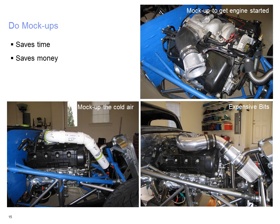And then to actually finish it off on the car, I knew I was going to have to do a snorkel inlet that is very tight under the hood, and it was going to be difficult to lay it out just by looking at it. And once I actually looked at these parts, it had to be by a company called Spectre, but they're very expensive. But I noticed in their online catalog they gave the dimensions, and I went to my local hardware store and I discovered that I think it was 3-inch sewer pipe had very, very similar dimensions. It had the same 90 and 45 degree bends, and of course straight pieces. And so you can see down here in the lower left where I used those sewer pipe pieces to mock up what that final piece is going to look like down here in the lower right. And that really saved me a lot of time.